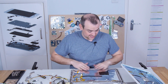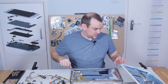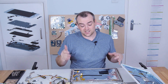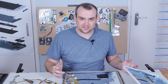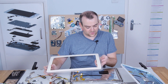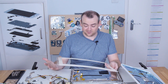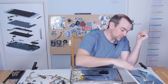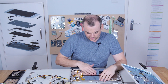As far as I can tell, this LCD assembly is standard — there's nothing special about it. The only thing slightly special is this die-cast aluminium around the edge which clips into the frame, which is a lovely frame actually. If you were doing something like taking a 17-inch laptop screen and modding it, you'd probably have good luck getting that in. If you were really clever about it, you could probably make that bezel slightly smaller as well — there's still a good 20-25mm of white bezel here. You could probably get an 18-inch 1080p screen in there with a nice LED-backed panel. It's totally feasible to either reuse or replace the cables running up the arm — great for a modding project.